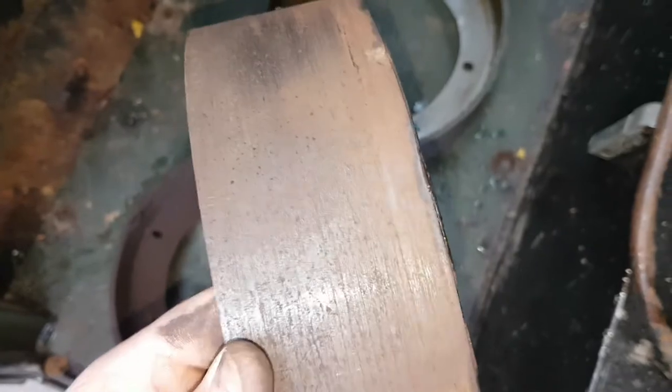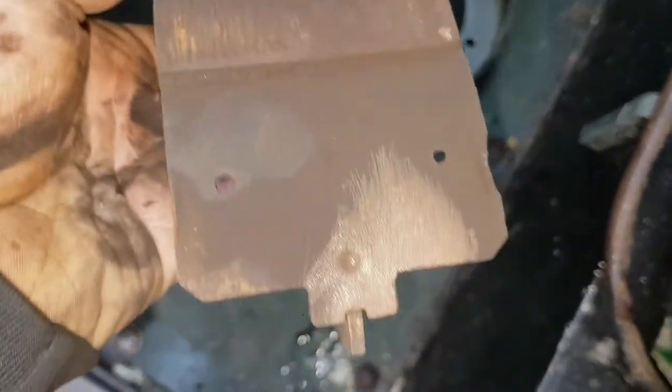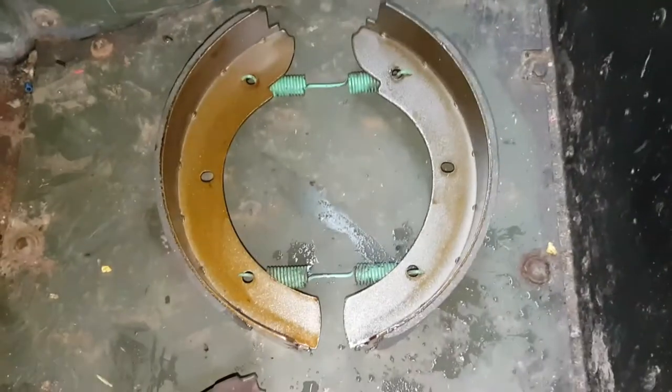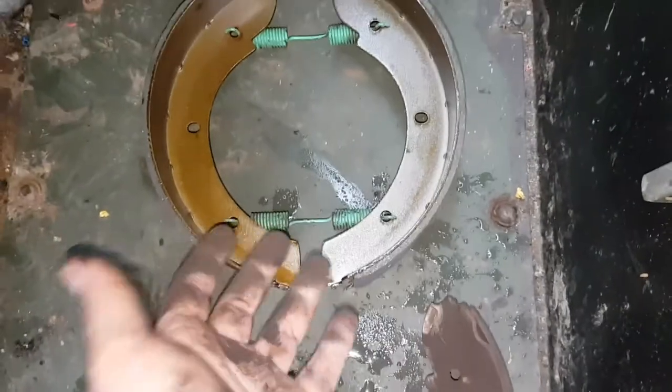This is who keeps sitting on my lap while I'm trying to work. Examining the old shoe, you can actually see on the right hand side where there's a chunk missing where it's binding. Bone dry. So I'll put a little dab of copper grease on bits like these contact points. The spring's cleaned up — it's really ready to install, but I'll have to clean the drum up before I put them on.